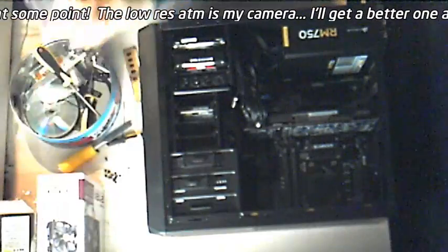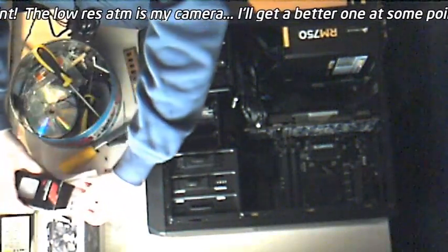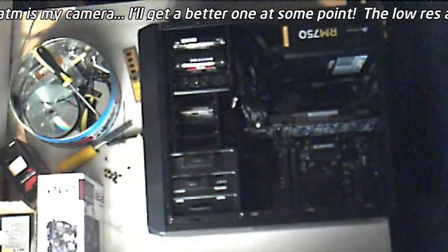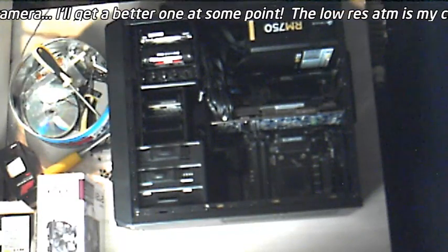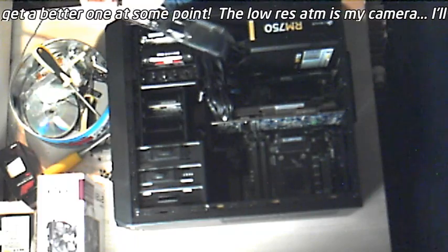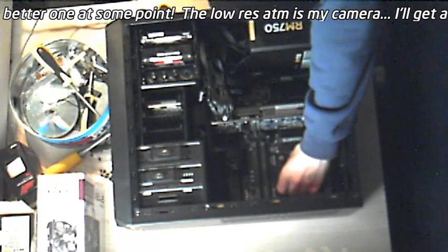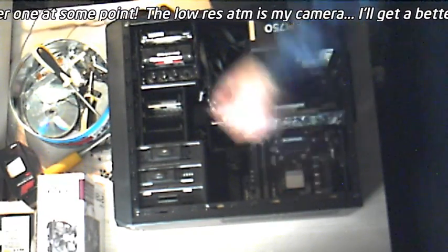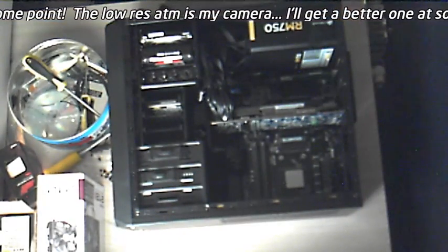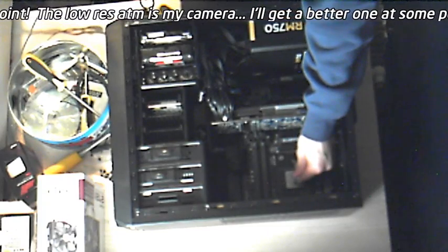Anyway, CPU. So, again, from the Microterror, I'm using my FX 6300. You can see the Hyper 212 there without its fan on it, but yeah. CPU is going to be this beast, and let's sling it in. So I'm just going to grab that, take this, pull the chip out, drop it in, lock it, give it some thermal compound, slam a heatsink atop it, and bang, done. This system will then be bootable.